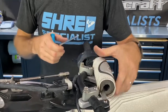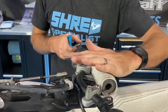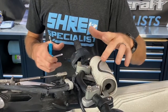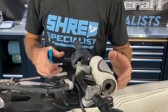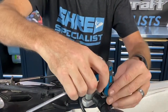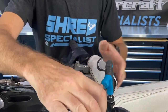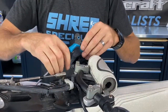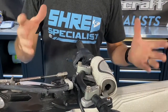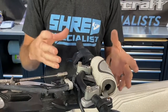The crossbar pad is intended to sit on top of the new relocators to protect yourself and your face or body from hitting the bar clamps — kind of like the OEM little pad that was there. I'm going to double-check all my hardware. Loctite everything on your final install; we provide some Loctite in this kit, but any Loctite is better than no Loctite. From there, just put on the handlebar pad and that is the install.